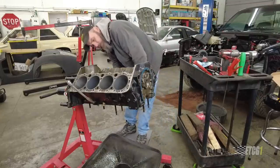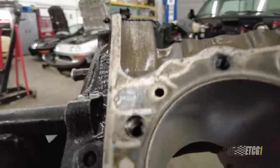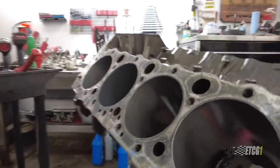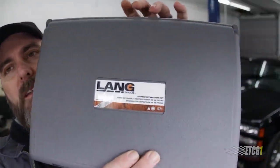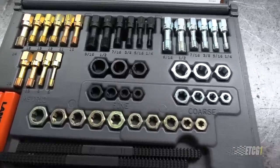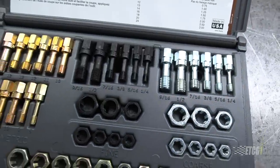If I'm going to point to one thing, that's going to be it — just honing. Now I'm going to clean it up with some soapy water. In addition to honing the cylinders, I also ran a tap through every threaded hole in the block to clean out any dirt, debris, and RTV. But in the future I'm going to be using a re-thread kit, which is designed not to be harmful to the threads, whereas a tap is designed to actually cut new threads.